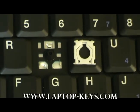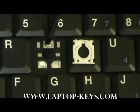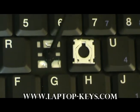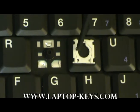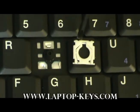To determine this, you first must see if it is rotated correctly. There is a metal tab in the center and then there are two outer metal tabs. This upper center metal tab needs to align with the top of this keyhole-looking inner clip. There is a piece of plastic that is going to slide underneath this clip. Therefore, this clip is rotated in the correct position.